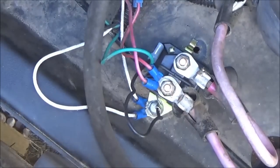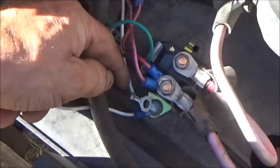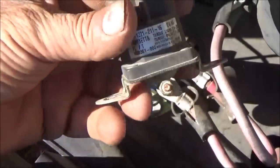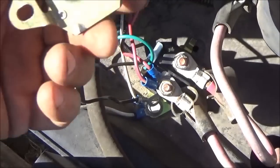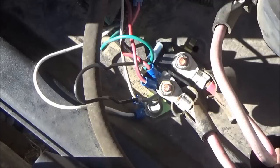It came with this extra grounding wire — I didn't know what that was for. I just now found out why it came with this: my original solenoid is obviously self-grounding through the chassis or through the mounting plate, and this one isn't. So I just plugged that wire in, touched it down here, and it worked. I'm going to take this screw back out, put this wire under that screw, screw it back down, and then we'll be fixed. So you don't always have to have the exact same part. It works better when you can get that, but it's going to be a headache to order it online and pay shipping when I can just go to a discount farm supply store and buy the solenoid for 11 bucks and be home with it. So there we have it. Thanks for watching.